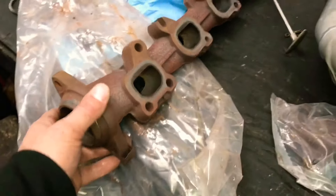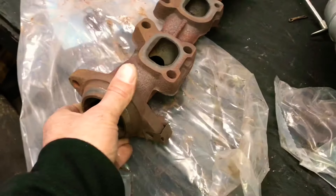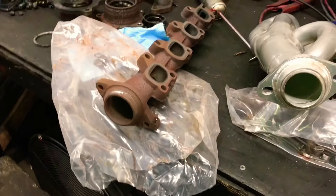These manifolds are going back on and I've got a funny feeling I'm going to feel a little more torque. You're going to have more peace of mind not hearing exhaust leaks — no more ticking. So in my opinion, are manifolds better? In this case, I'm going to say yeah. And I'm not just saying that because my headers are leaking. If I knew that the exhaust outlet was bigger on the manifolds, I never would have got the JBAs in the first place.